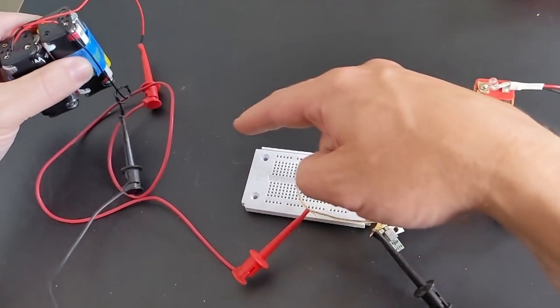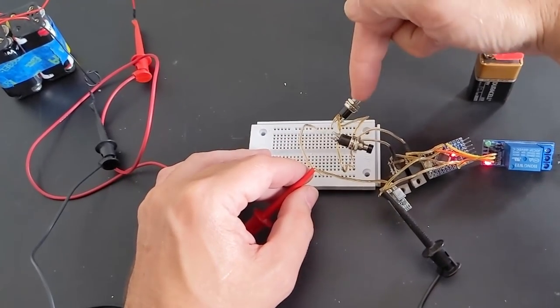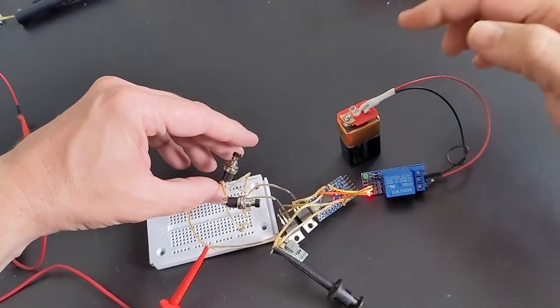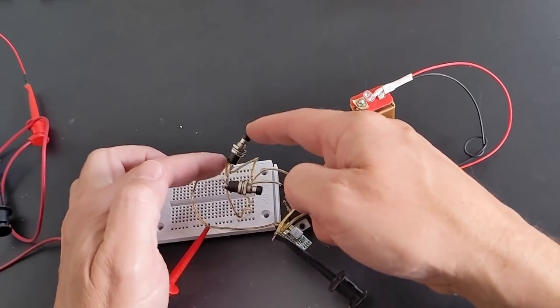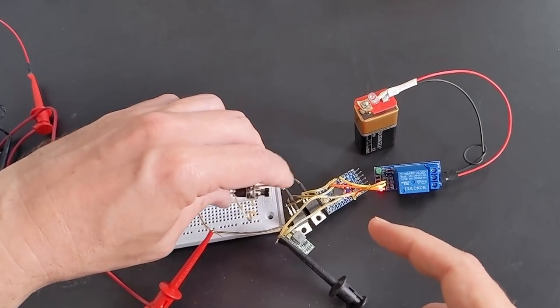Winner winner, chicken dinner. With the 12-volt battery feeding power through the switch assembly directly into the MOSFETs, we get nearly instantaneous light — no delay between when the 12-volt signal is sent and when the light responds. This is ready for testing inside the motorhome.